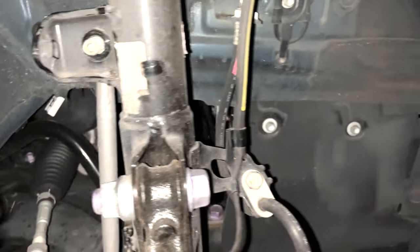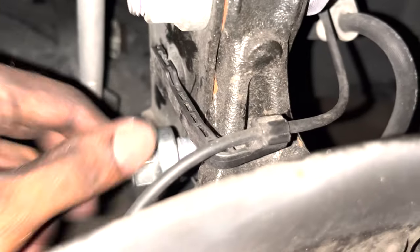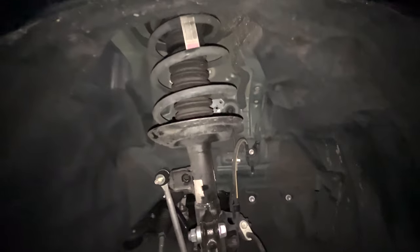TruHart coilovers with the camber up top — a very easy job, just the same as mine. We've got the top two bolts and the bottom two bolts to hold the knuckle, and you have your stabilizer link bar which already popped out, which is going to make it a lot easier. Once you disconnect one, two, three, and four, you hit the top bolts, which you access on the top side of the engine bay, and then you'll have this side down.